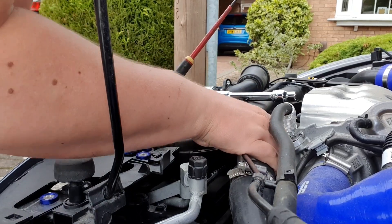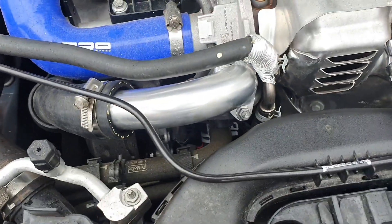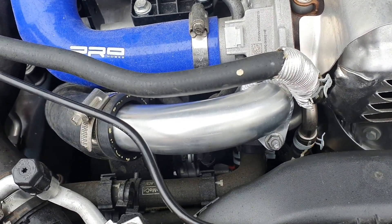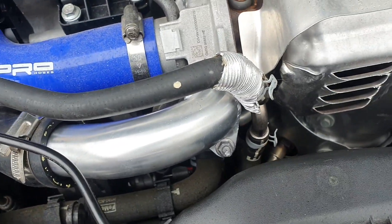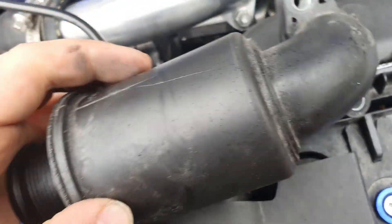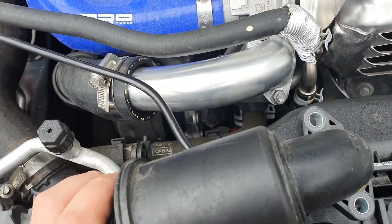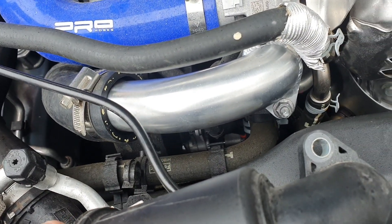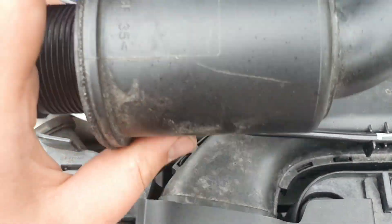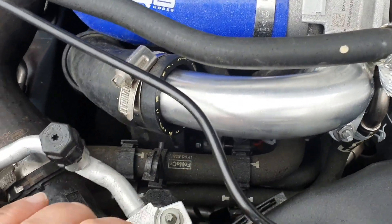I don't think that's going anywhere. Hopefully we'll get a few more whooshy noises - we don't know. It's looking so much better, going well with the other hoses. It's not hard to fit really - just undo that, take the two nuts off, take that out. See the difference? This one's a bit thicker but it's plastic, whereas the new one is aluminium. It makes it easier for the air to flow around the corners, and it's curved all the way whereas the old one was straight then curved at the end, so it'll have more airflow to the turbo.